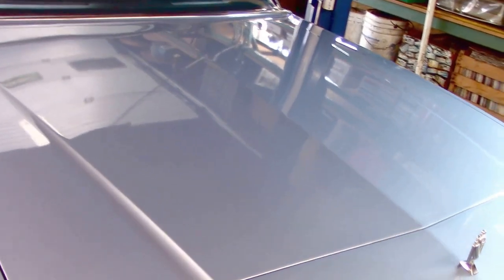Now topside — you can see the hood and all its luster in the sun. Being my own critic, in some areas — it seems to only be topside — there are fine microscopic cracks in the clear coat finish. I went back to the painter and he said you'd lightly wet-sand it with about 1000-grit if that bothers you. You can't even see it, but I want everything out in the open.